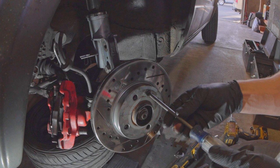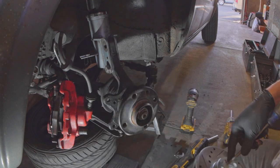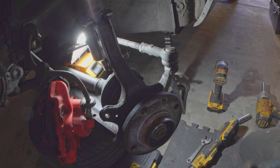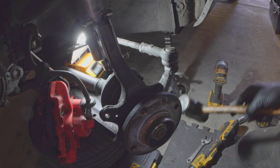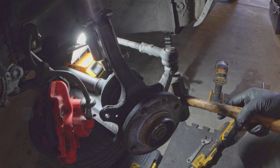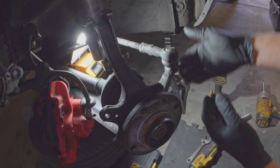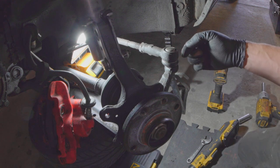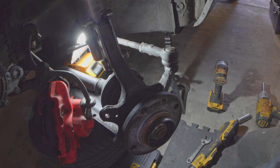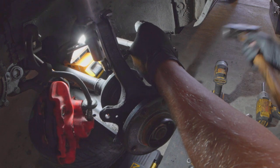Take the screw off your brake rotor — a lot of vehicles just don't have anything holding the brake rotors in. You want to take a big hammer, probably the biggest you've got, and tap it right on this ball. If you hit the threads, you're going to damage them. This socket is like two different size cones that press into each other, so hitting it axially isn't very effective. But if you hit it laterally, you're actually deforming the outer cone slightly.